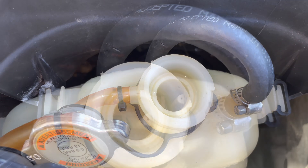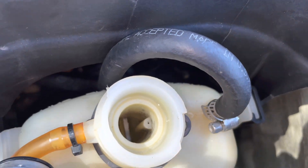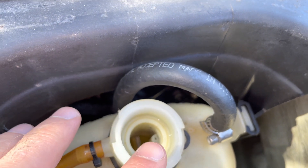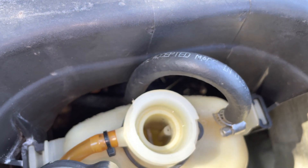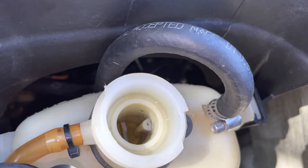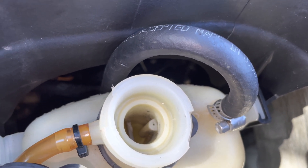Let's strip further and see what's going on. Just before we strip out, usually you do get a little bit of black pieces inside of the water bottle, which is a little bit of head gasket flaking off. But this is more a head gasket and carbon compound build-up, which is abnormal.